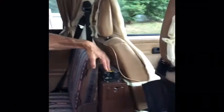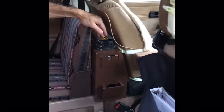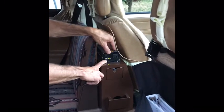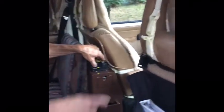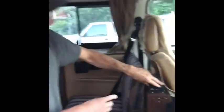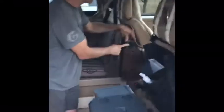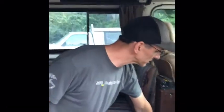For power while camping, there's an inverter that connects to a camping battery stored under this seat. That battery charges automatically as you drive — it takes about 45 minutes to an hour to fully recharge. There's a USB plug here to charge your devices when the van is running or not. There's also a USB charging port above the glove compartment in front. If you use the 110 outlet, it will drain the battery much faster, so I recommend using the 12-volt charging cables.